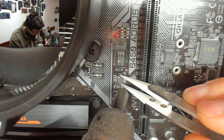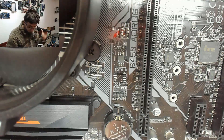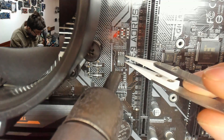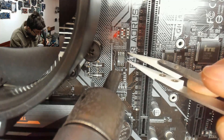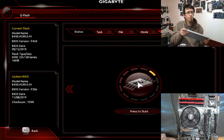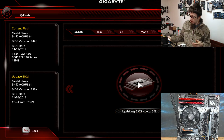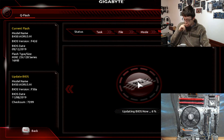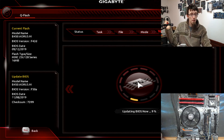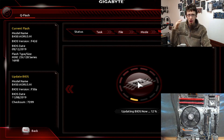So the first thing I did when making this video was I reflowed the solder joints on the BIOS chips, and immediately that fixed the BIOS-resetting issue. That problem stemmed from the previous repair video and was totally my fault — all fixed now. I also got word in the comments that BIOS version F50A was out, so I flashed my board up to F50A and I can report that it immediately feels a lot better. The slow post times and other general weirdness and lack of confidence from the board is gone, and it's completely restored my confidence in the board as a whole. F50A is an absolute winner.